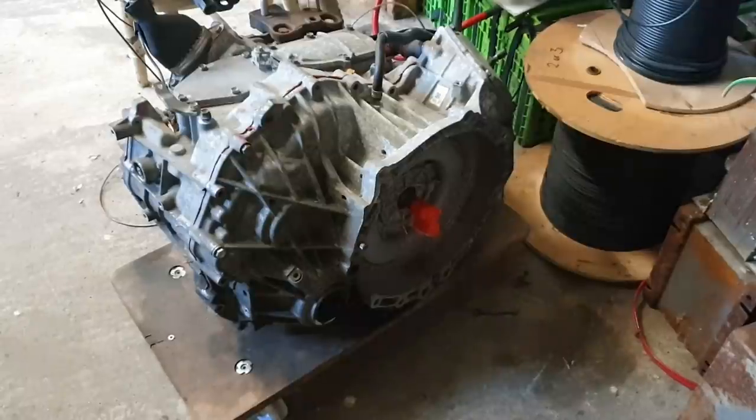Okay folks, so a couple of days have passed since I was shooting the last segments, and Johannes and I worked on a particular problem that we were experiencing both with the Gen 2 and the Gen 3 system. And that is when we would reverse the motor after having successfully tuned it, there would be very unpredictable behavior, like the motor would run away by itself and accelerate, decelerate very violently. That turned out to be a little bug in the OpenInverter FOC firmware that has now been fixed.